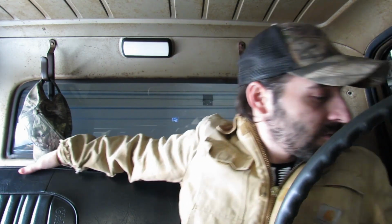Alright, let's start troubleshooting. I'm going to grab a test light and we'll start at the fuse box because there's an actual glass fuse labeled heater. So we'll want to start there and make sure we got a good fuse and we got power coming through.